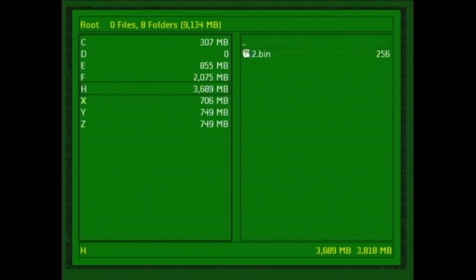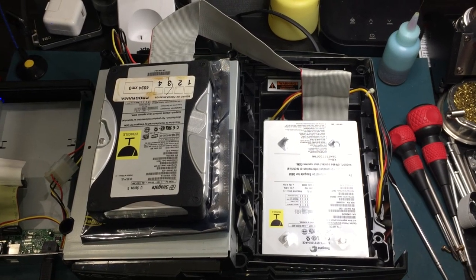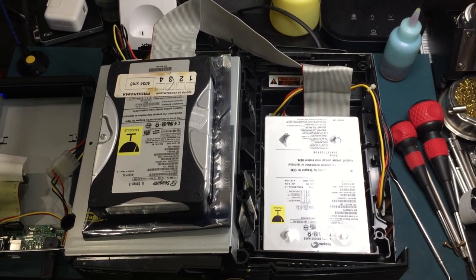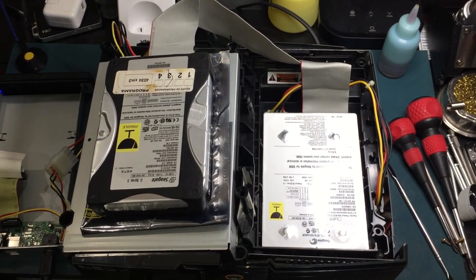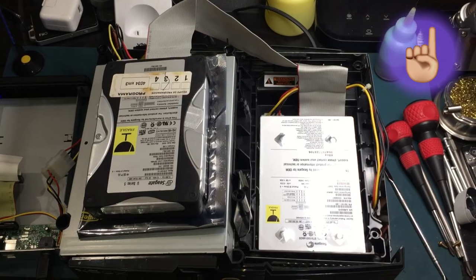Install Rocky5's Chimp 261812 on the working Xbox. Also, prep the error 16 hard drive and the working Xbox for Chimp 261812. You can learn how to do that here.